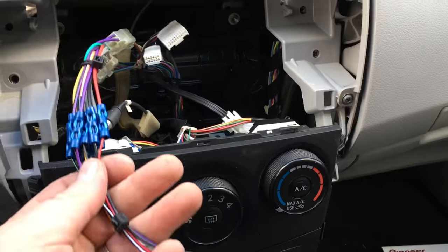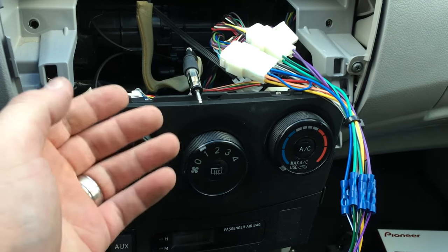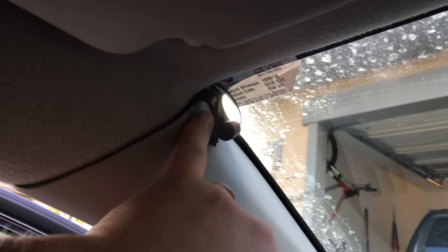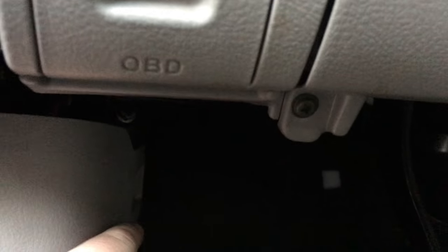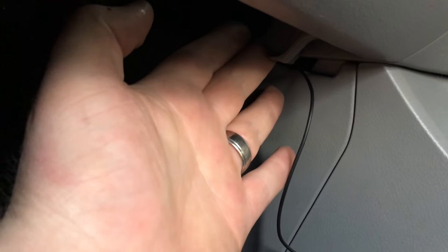With the radio out, we went ahead and plugged in our wiring harness adapter that we wired up in the garage — it plugs right in. These other two harnesses, if you have them, won't be used. Then our Motorola connection for our antenna will plug directly back into the back of the radio. If you have a Bluetooth radio, some of them come with mics and this one certainly does. I've clipped the mic right there and tucked the wire down here. I'm going to continue this down along the door seal and come out here, then go up underneath into the stereo cavity. I've tucked it all the way down. You can either zip tie it up above underneath the panel itself, or tuck it deep underneath the carpet by just pulling it back. If you can't see through and pull it by hand, you may want to use something to fish the wire up through.